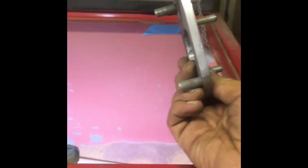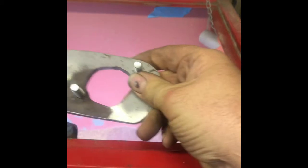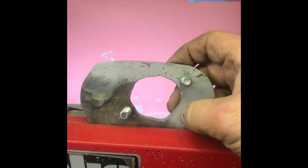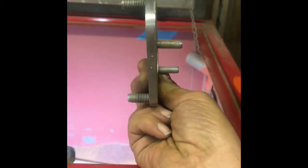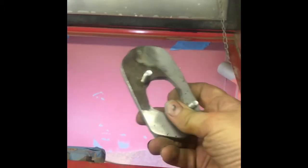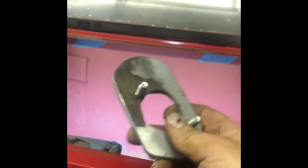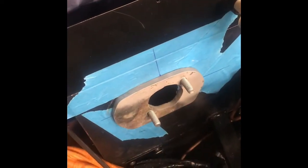Well, not the roundest of holes I've ever done. The plate I'm using as an adapter between the servo and non-servo master cylinders is about 8mm thick, which made it hard to drill. I didn't have a big enough step drill so I had to put small pilot holes all the way around and connect them together, then file it out as best I could. It's come out okay. I've also draw-filed the outside for a reasonable finish, then used the media blaster on each side just to show it's working - taking off rust and paint. Now I'm going to assemble this all up and show you how it goes together.